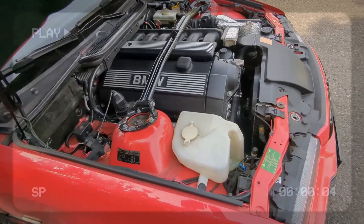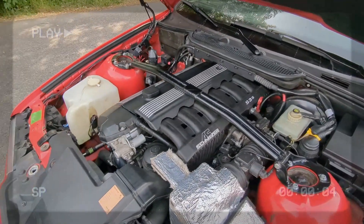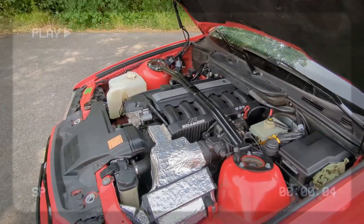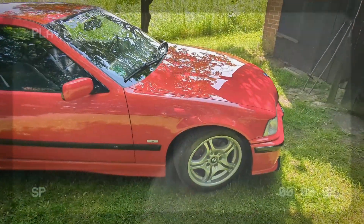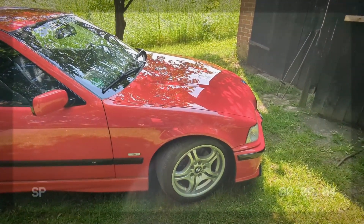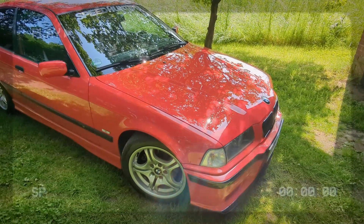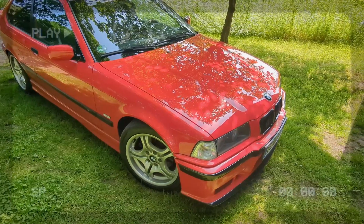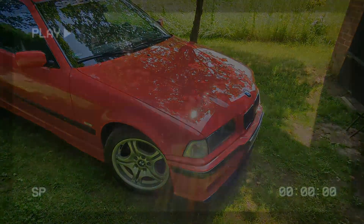That's just what I wanted to say about my electrical fan conversion and clutch fan delete on the E36 M52, and I hope you got something out of that. If you have any questions or comments, feel free. You can hear the e-fan turned on after the car shut off and then turned off again - it runs after the engine shuts off just to cool things down a little more, cooling down heat soak from the other components in the engine bay. Can't hurt, right?